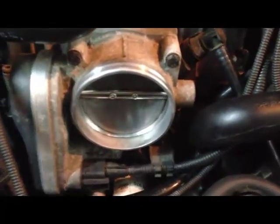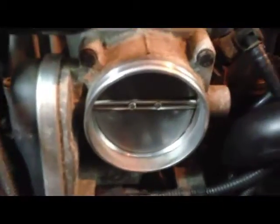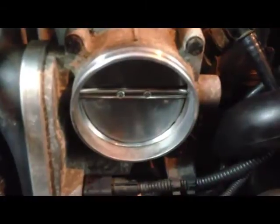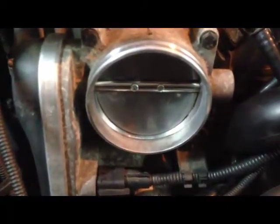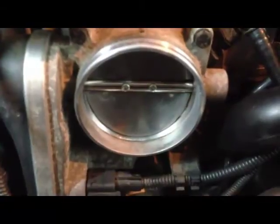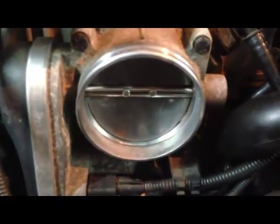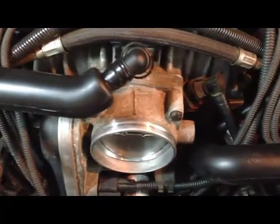Fuel injection cleaners cannot get to the area of the top of the intake where you would need to manually spray and perhaps brush or use a clean towel to clean the surface. But usually the intake sprays will do quite well in getting rid of that and dissolving the deposits. In addition, you may also want to consider cleaning your mass airflow sensor as well.